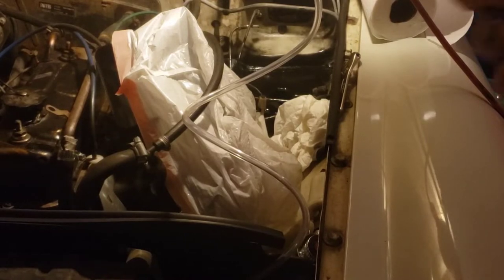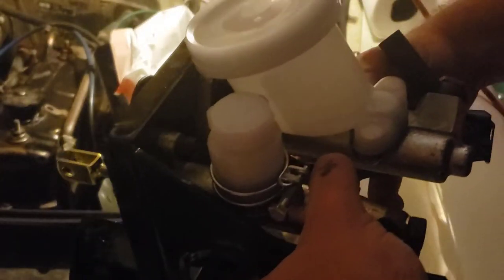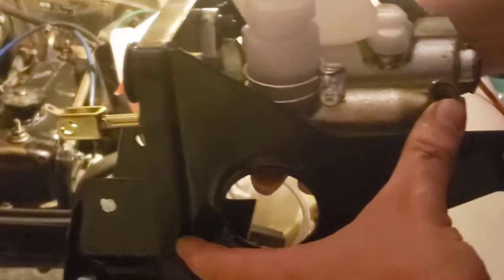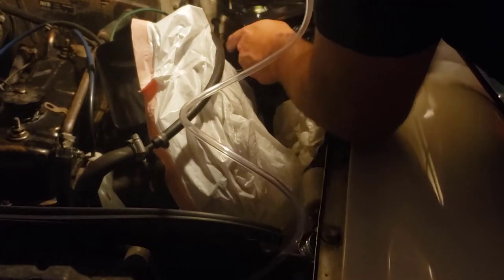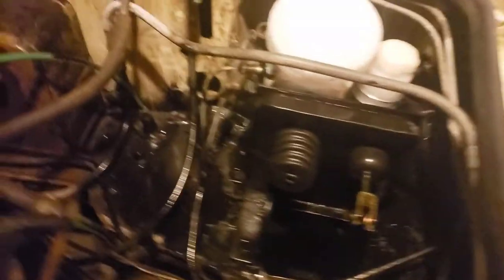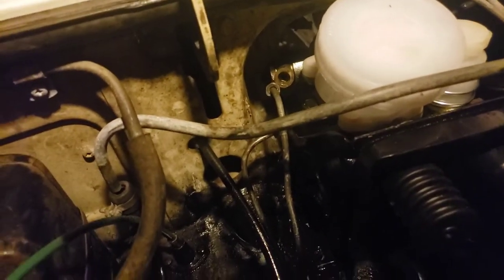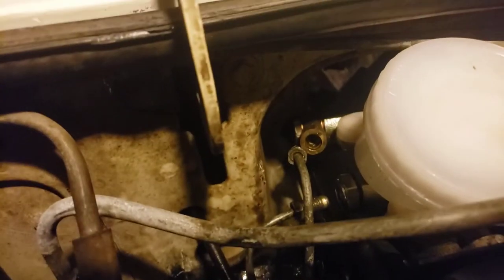Here's the bracket — we've got the masters back on. My plan of attack is to do a bench bleed on the car, assuming I can reach the back master for the clutch line, but I want to do a dry fitting first to see if I've lined up the banjo bolts properly with the hard lines. The master is in — the lines appear to be lined up on pretty much all of them. I'm really worried about cross-threading this one here, but I don't think we will.